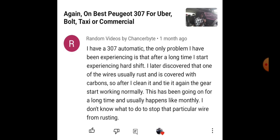Look for that same connector, cut and join, do it properly. A mistake people usually make is they bring a connector that has several wires behind it, numbered on each of the holes that the wires enter. They will just use pliers or a knife, cut all the wires as they go, and then bring the good connector they want to put in, and then they get confused. Oh, where did this wire come from? Which hole did it enter? And then start doing cut trial.